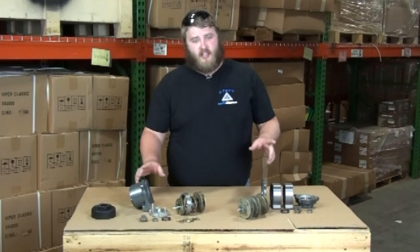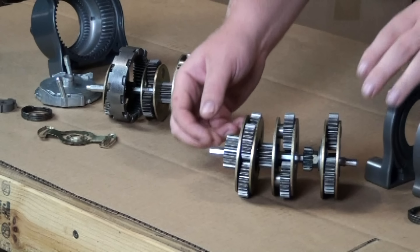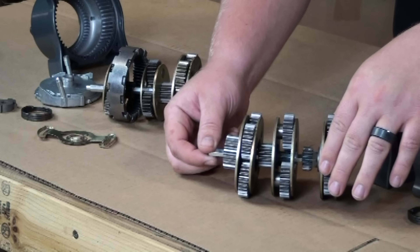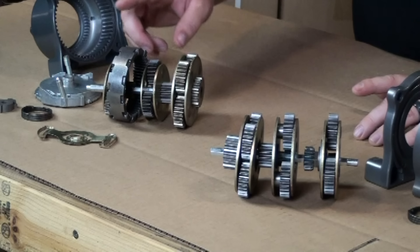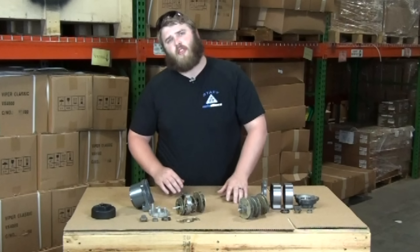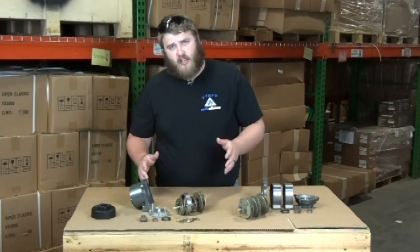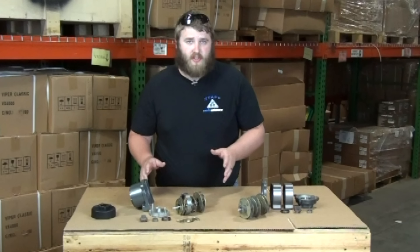The other major difference in the gear ends comes in the free spool engagement method. The Max winch has a cam follower which will push a drive shaft in and out of engagement with the planetary gear, while the Elite winches have two pins which will engage and disengage the slip ring. This allows for a very robust, very efficient engagement system which eliminates gear chatter and reduces strain on the electric motor.